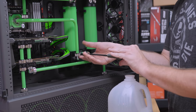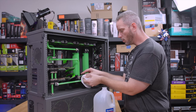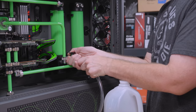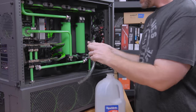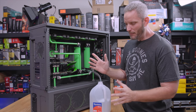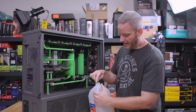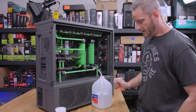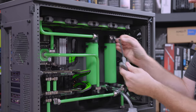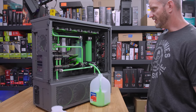I've showed this in previous videos, but I'm always asked how I drain my systems. I've got this drain valve — you can thread on a barb, in this case an Alphacool compression fitting — and just push on your fitting and stick the other end in a catch can or container. I've had this hose pop out and spray everywhere, but I can shove it right in the handle. If I open up this valve or plug on the top, air can get into the loop, and as soon as I turn this valve, physics takes over.